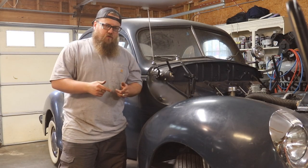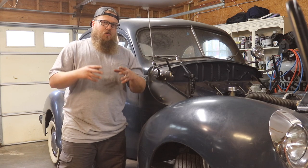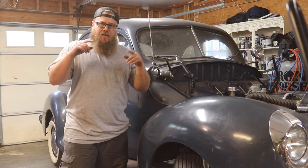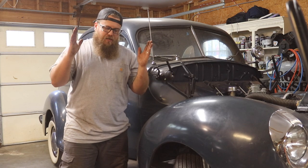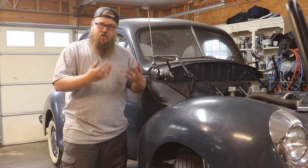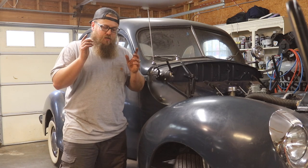There's a lot of misconception about these early Ford eccentric brakes. They have just as much stopping power as the more modern style drum brakes. The difference is they're not self-adjusting — you have to maintain them, you have to adjust them. It takes a little bit more extra time. Something you might not know if you're more familiar with modern drum brakes: since these are eccentric and these shoes start to wear out, they'll be less and less capable of completely stopping that drum. You have to, in intervals, pull it into the shop and adjust the contact just like I showed you in this video — which is not that big of a deal, especially if they're in good condition like this one was.